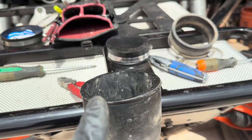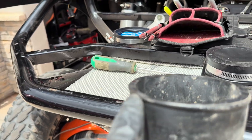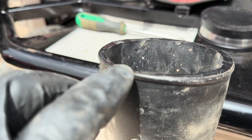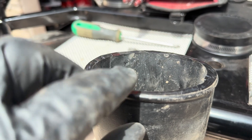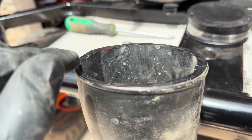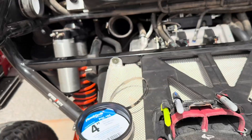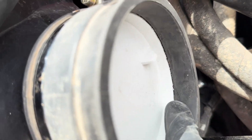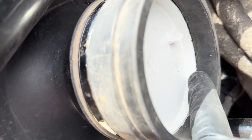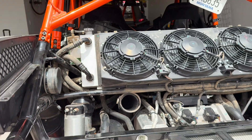It wasn't feeling comfortable at the fit, so with just a handy dandy sharp razor knife - this has got a little joint on it to hold it that drops into that channel so it can't come loose - it had about an eighth of an inch of material sticking out on each side in front of that lip. So I just went around and easily shaved that off with a razor knife. Then inside my connector over here I also trimmed the height down by about an eighth to three sixteenths of an inch to give it a little bit of room so we're not scrunching things up too tight.